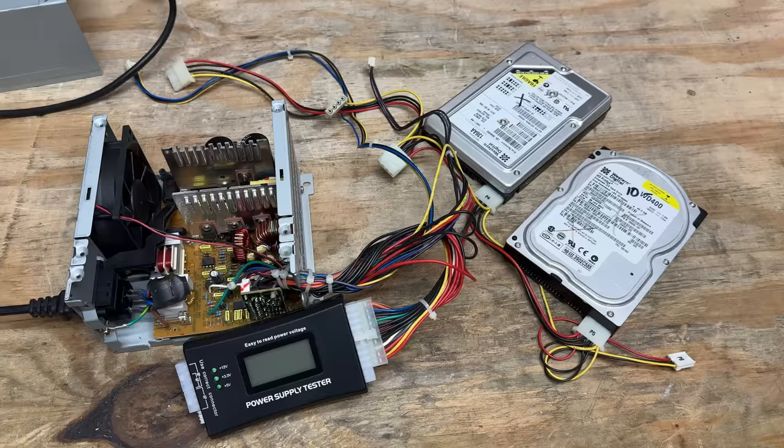Let's pop that drive out and find the source of all those angry sounds. Opening up for no reason - now it's sounding better. If I press the button, nothing happens until I give it just a little tap, and then it opens just fine, but that only happens if I push the button first. The switch is perfectly fine. It's definitely detecting the button push, but why is it not spinning down the disc? I'll take it completely apart, clean and lubricate everything, and see if we get any better behavior.